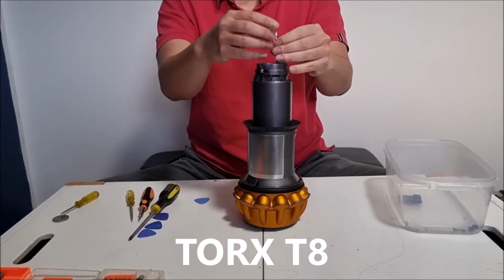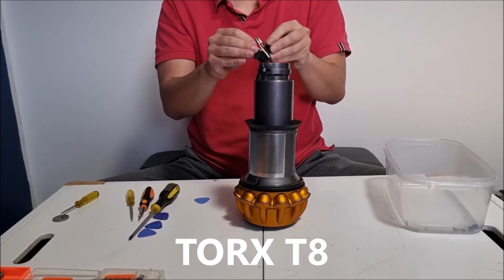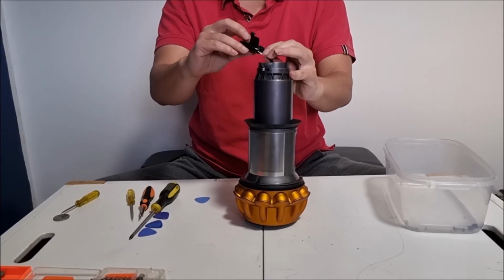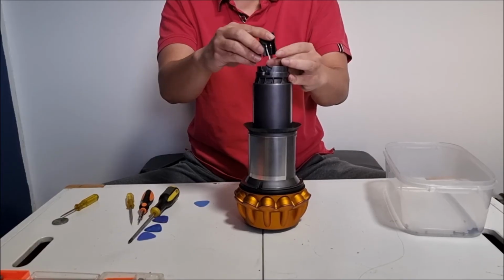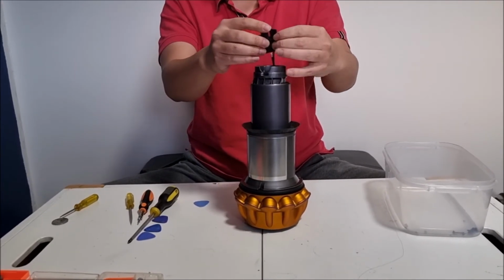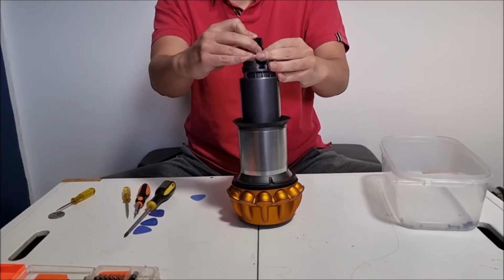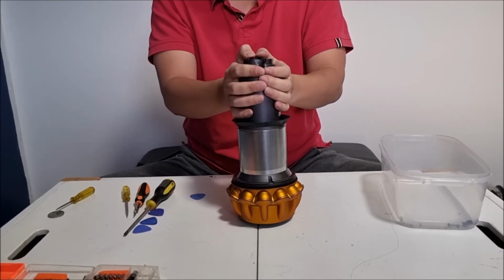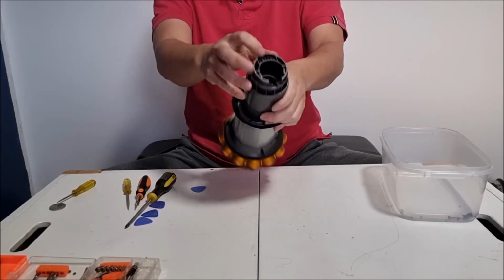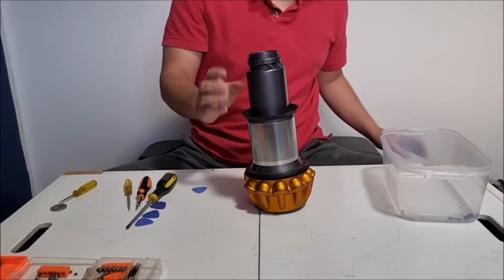Now we have to put the connector back in. Remember, the white one goes in where the hinge is, and the black one goes where the door knob is, whatever, the closing part. Remember to put it in deep enough and facing correctly so that when you close the door, it locks in place. You know it's locked in place correctly when you pull on it and it doesn't fall out. So to push it back in is how we put it back in properly. Once you put it back in, tap it a bit to ensure it doesn't fall out or move.